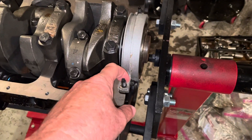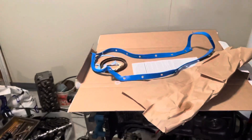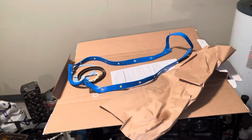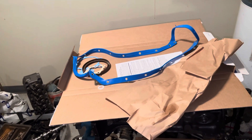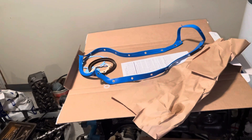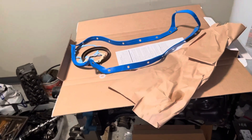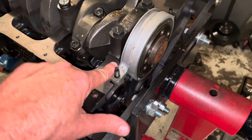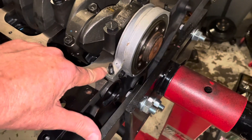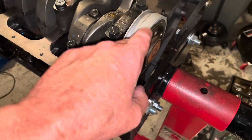I cleaned it up very good and put a paper gasket — this is the oil pan gasket, but it's called the lower half of the engine gasket set. It's kind of expensive, about $65 for that set of gaskets. One of the gaskets in that set is the gasket that goes between the rear main seal and the block, and I've already put it in. I put gray silicone seal between the block, the gasket, and the seal.